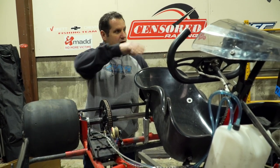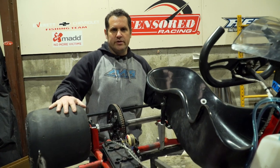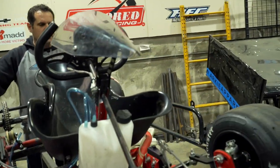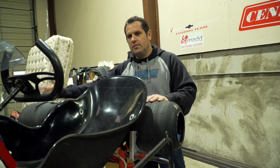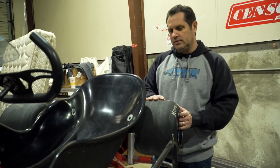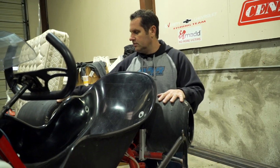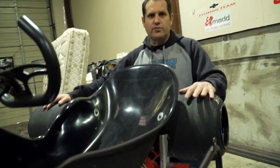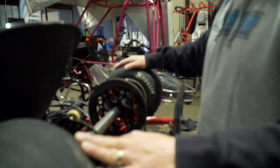I always work on corner entry — the right front tire — the same with my modified, late model, any car. Moving axle height up or down can get more side bite, which is more weight on the right rear as you're getting in. You always want to adjust the cart from the flag stand through the corner. If the cart is loose or sliding out at the flag stand, that's where you start. You can also move your lead around — too much left side weight makes it loose getting in, too much right side makes it tight.